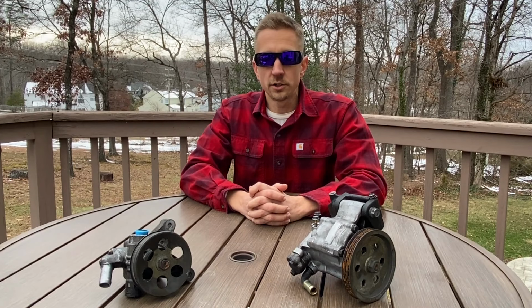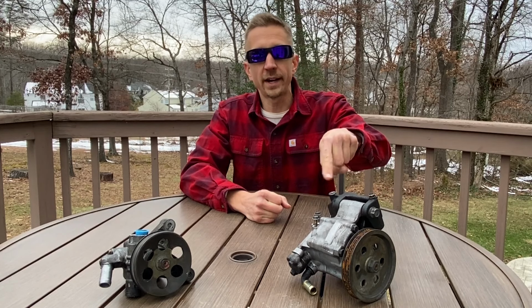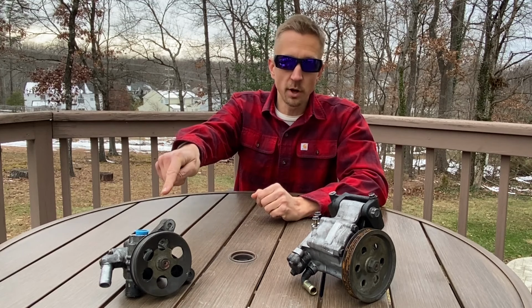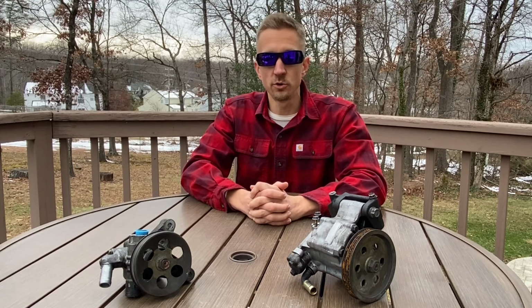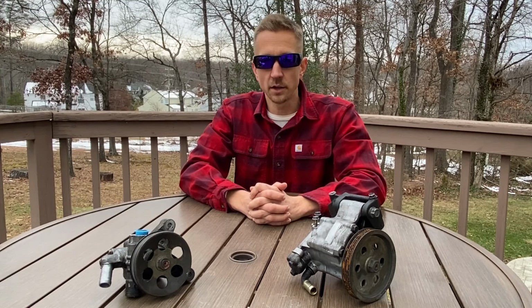Alright guys, that's all the time we got left for today's episode. We were able to experiment with the F22 power steering pump and bracket, in which I didn't have any success. Now the H22 pump, bracket, and power steering hose head needs to be utilized when doing an H22 swap on a CB7 CB9 Accord. Now the pump is still making a slight whine sound at idle and with any steering wheel movement, and I'm going to take a look into the resolution for that. Hopefully it's an easy fix, and I'll be sure to let y'all know.